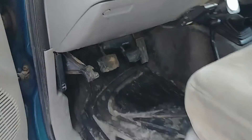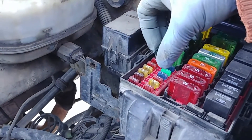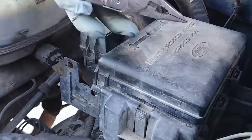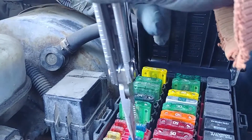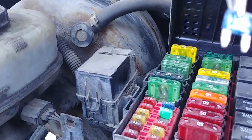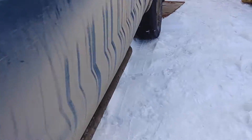Let's go and turn the lights off, and I'll show you how to find the fuse box. Open it up — usually under the hood. You'll find the fuse locations on your vehicle. This fuse is number seven. Ford doesn't always give a description on the lid, but you pull the fuse out and check it. Our fuse is good because we still have lights. A blown fuse will be visibly burned. That's the first step — put it back; it's all for demonstration.